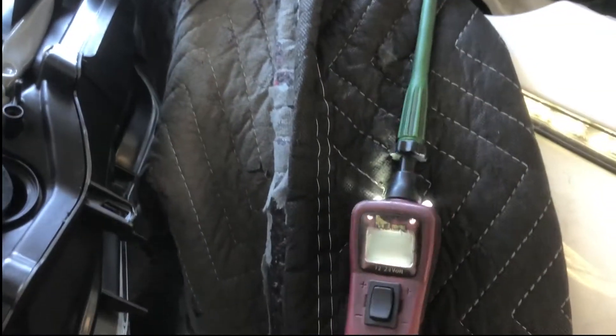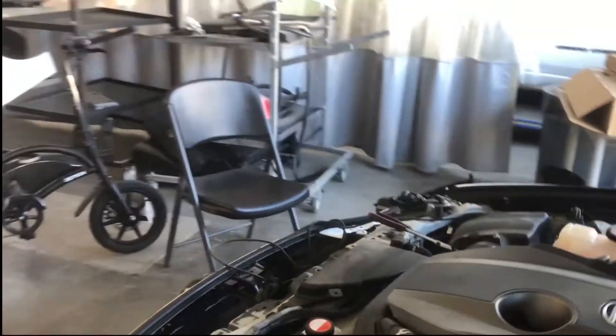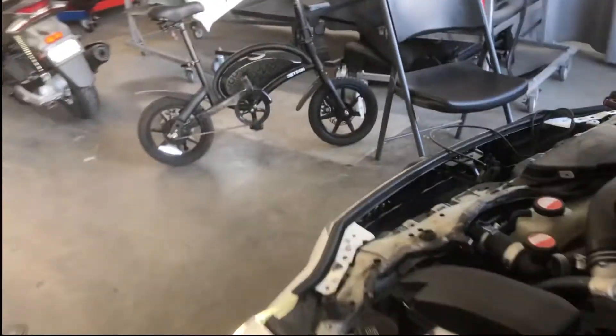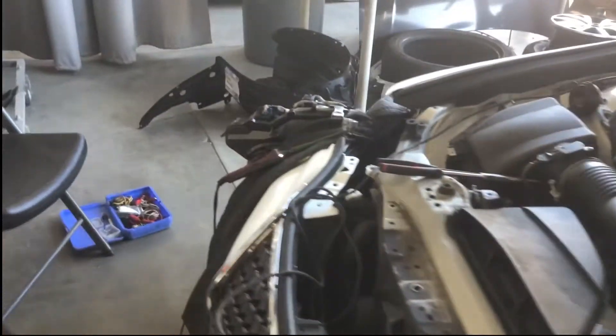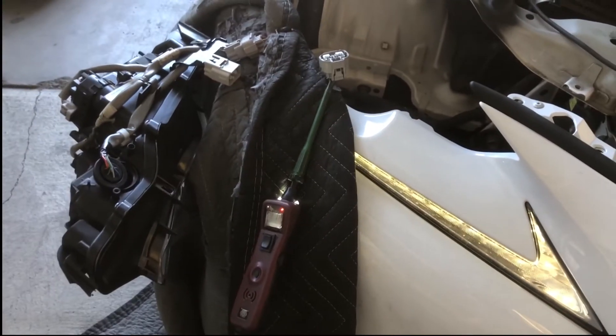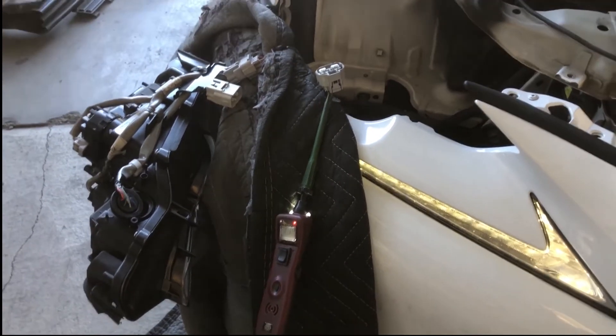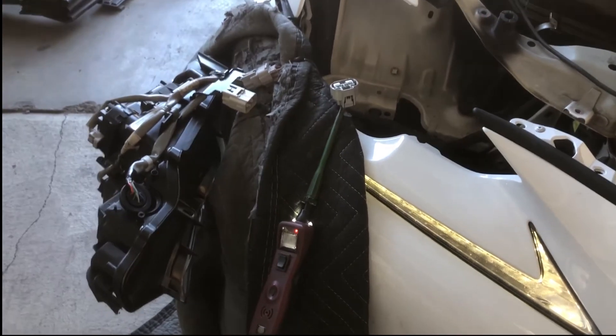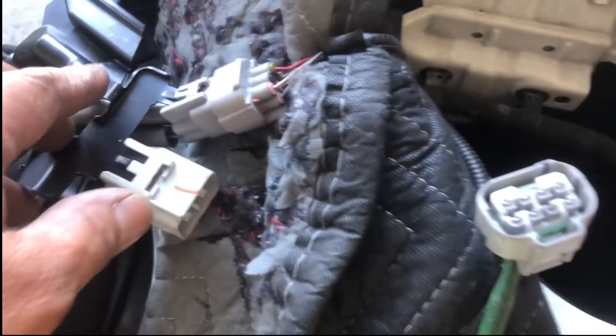What I'm going to do is put my probe on there and it should light up red on the LED light, indicating that there is power in the high beam circuit. I got the key on and as you can hear it's throwing out a positive. That tells me that the system is working from the lever of the high beam switch all the way down to the blue wire right where it plugs into the housing.